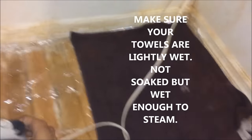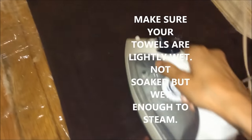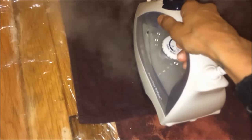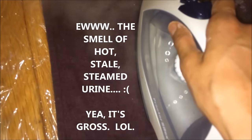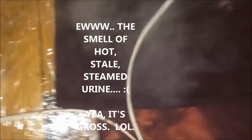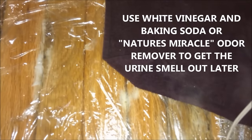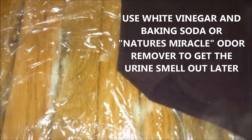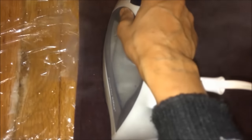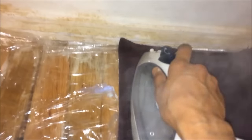I'm going to show you what I did to steam the developer. The towels are wet. Just leave it for about 5 to 10 seconds in each spot until the towel gets really hot. Then you just lift it up a little bit to see that the plastic is getting warm — if the plastic is not getting warm, then it's not heating it up. And it is getting warm, so you can do that in every spot that you need to steam it.